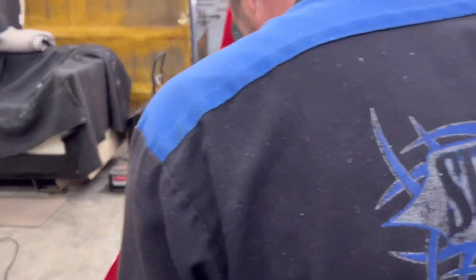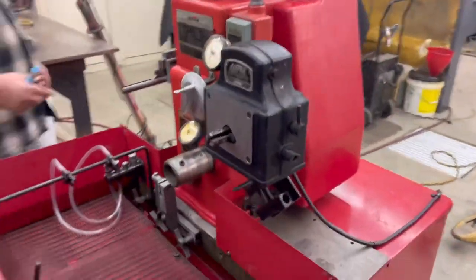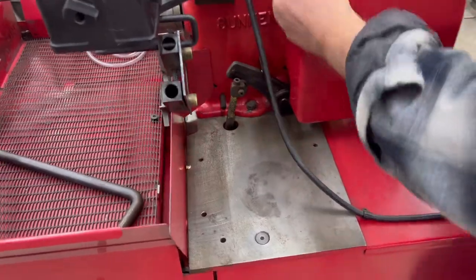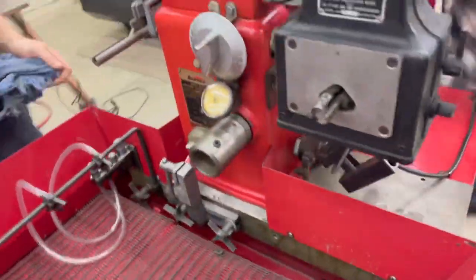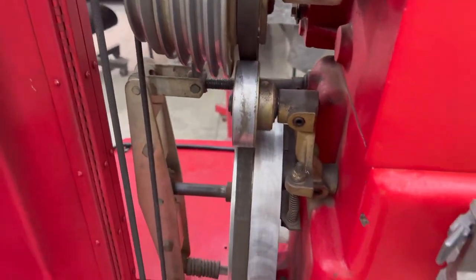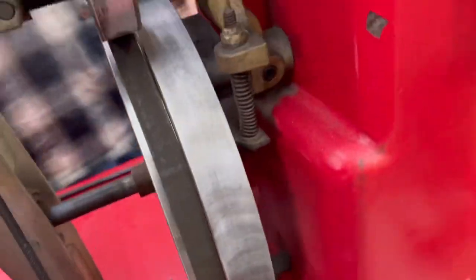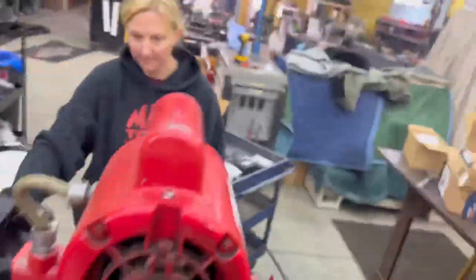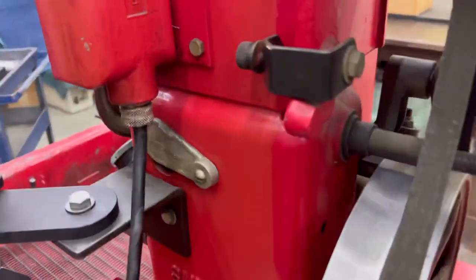Okay, step on your pedal and watch what happens. Julie, go step on it. Anthony, you need a step? All you're doing is kicking that idler and making it draw. Oh, okay, so down is tight. That's adjustable. This idler position pulley can be adjusted using this screw that's behind this cover. Okay, that's your belt adjustment.